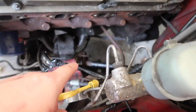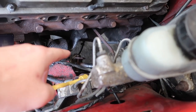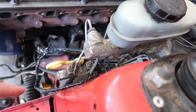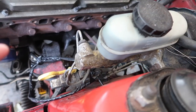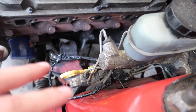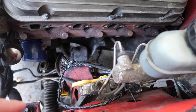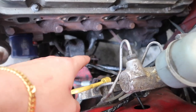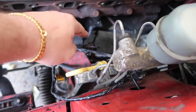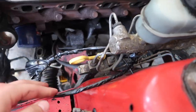What we're doing today - I ended up buying a blow torch because we're going to heat up that one bolt that's keeping the old steering shaft on. I need to get that off so I can immediately buy a new one and get the whole steering done. I don't want to put this header back on yet because it gives me good easy access to deal with the steering shaft.